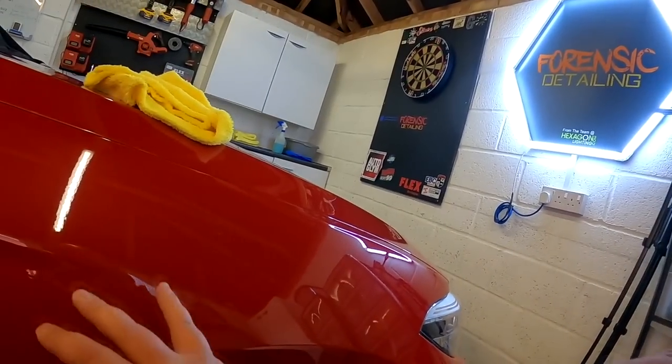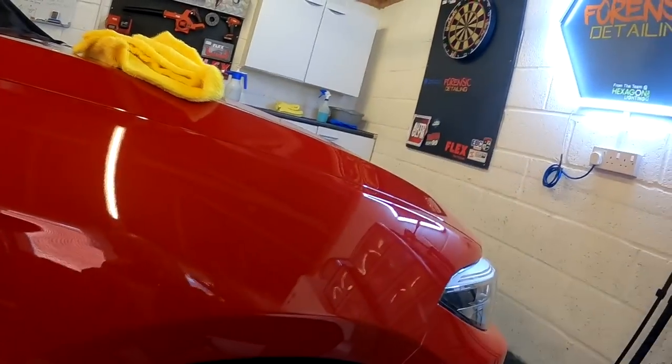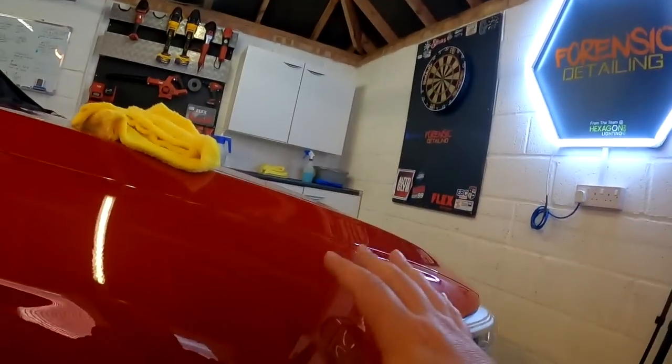The key thing that you'll see with that polishing set is me really taking my time and really making sure I cover the entire area that I'm polishing. If I don't do that, when I wipe down, I'll find little patches where I've just been a little bit careless and I've just gone quickly over one little bit and I've not taken that time to really polish it. And I'll see a little cluster of swirls that I haven't taken out. So that's why you see me doing it that way. Some people will say you're doing it far too long, but if I go over it quickly, the results won't be good. I'm trying to see if it's possible to do all of the work in one set.